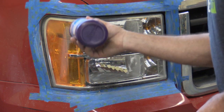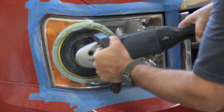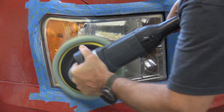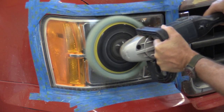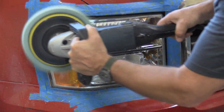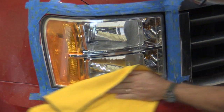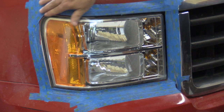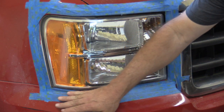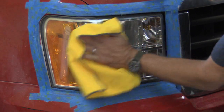We'll go ahead and do this final piece here, then we'll take a look and compare it. Same thing — just get it on the pad, we're going to spin this one up pretty good. So that was it. We'll just give it a good cleanup here on the edges. The tape held up pretty good from getting through to any paint. It burnt through a little here. So on the bottom section when you tape it, I would put like two, three, four levels of tape if you have a real good paint job, because you just barely touch it and it's going to mess it up.